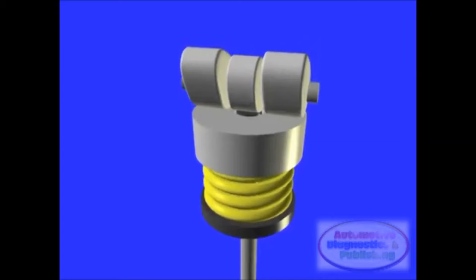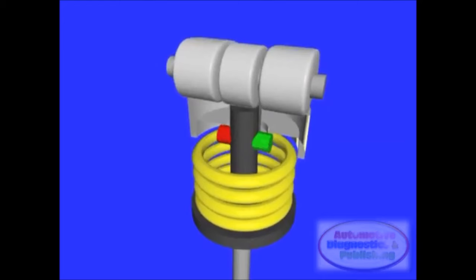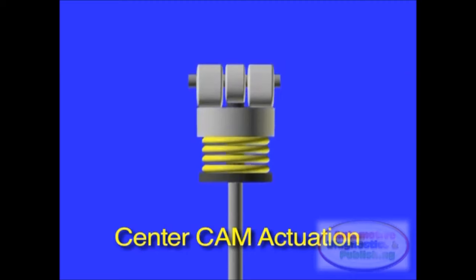However, the most influential change of the Variocam Plus is the addition of variable valve lift. It is implemented by using variable hydraulic tappets, with an attachment pin. As shown, each valve is served by three cam lobes. The center one has obviously less lift and a shorter duration valve opening. In other words, it is the slow cam. The outer two cam lobes are the same, with fast timing and high lift.